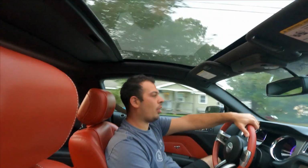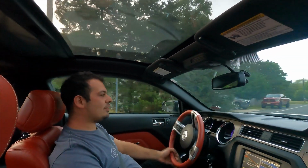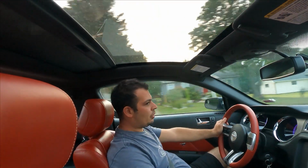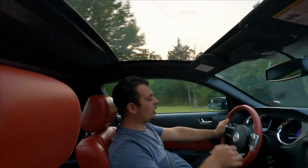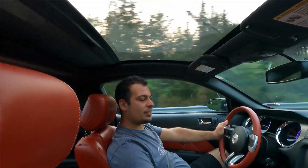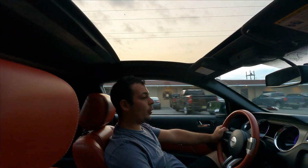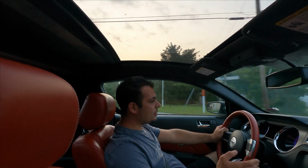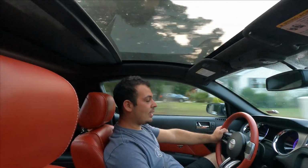I'm at the point where I'm probably going to order 4 oxygen sensors and just throw them at it and see how we make out, because here in New Jersey, this car really does need to have an emissions inspection. Right now, we have no check engine light. When we bought it, we did have to replace the canister purge valve because of an incorrect purge flow code, but it's been great since. No codes, no issues. It won't run the monitors, and it's driving me insane.